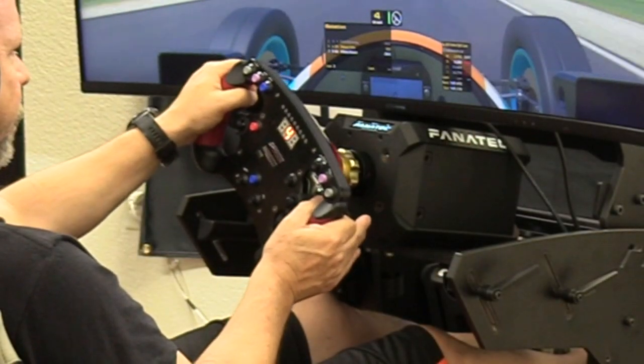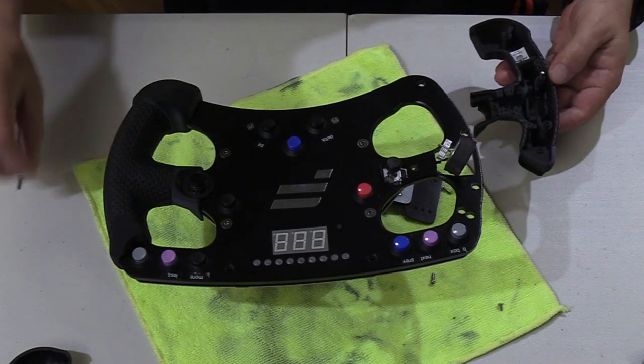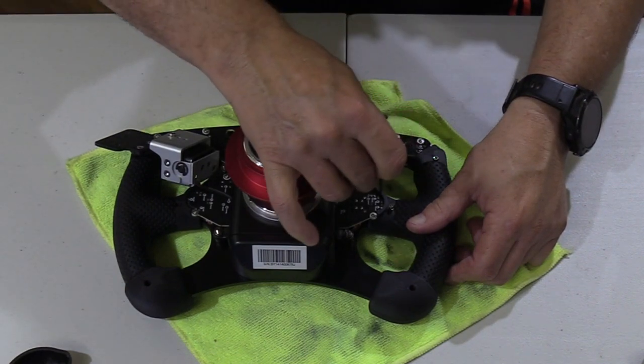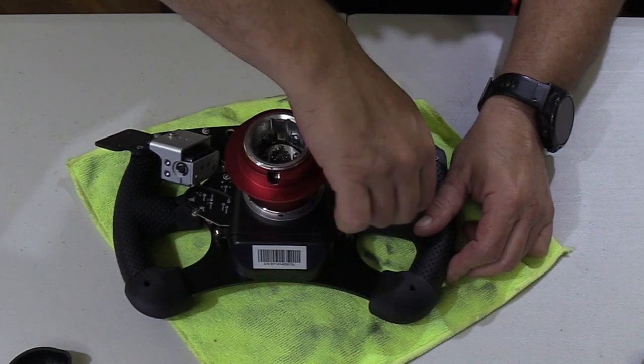I was also sent a pair of the 3D printed Pineapple grips so I could feel and see the differences. The biggest difference: I wouldn't have had to tear my wheel down, send grips in, and wait. I could order the 3D printed grips, wait for them to arrive, then go right into the process. The process is largely the same — the biggest difference being alignment pins that need to be installed on the new version, plus machine screws included to put it back together. Nine steps to remove the grips, work those steps backwards, and you have a completed wheel again.